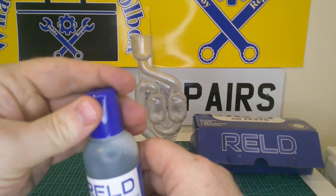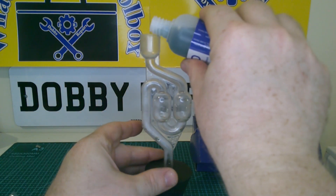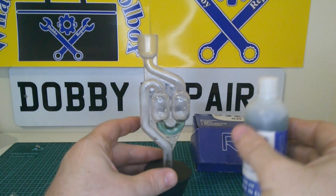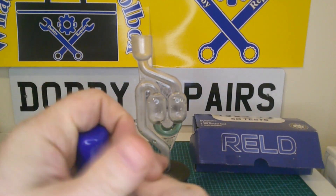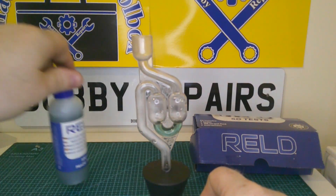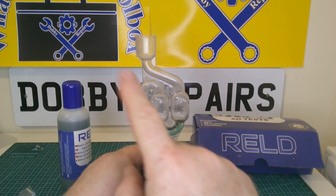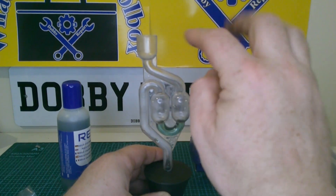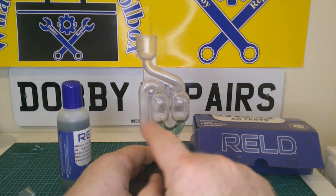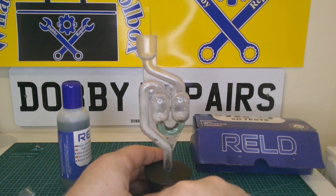So let me show you how you put your fluid in — it's really quite simple. You just open the bowl and tip a small amount in, just enough to cover that little dip in the middle. The gases come up through here but no fluid can go the other way because of the airlock — no air can come down from this direction. It's very much like if you're fermenting beer. The gas passes through and changes the colour of the fluid if there are any exhaust gases present.